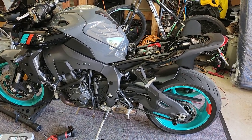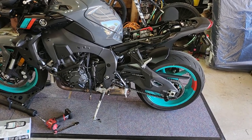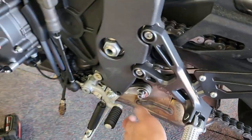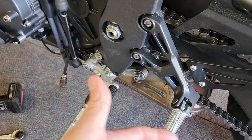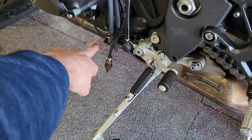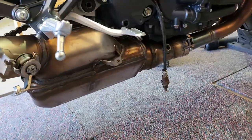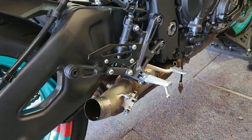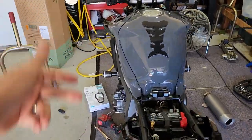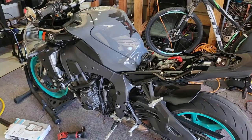All right, so we'll finish up this episode of Dave's Garage. I'm going to remove the cat I had put in loosely just so it wasn't blowing out my eardrums when I fired it up. I just need to take out that one bolt, remove that, and all I've got to do now is wait for the Leo Vinci D-cat to come in. I'll do a video of putting that on. I need to put in my O2 sensors, clamp the pipe on the headers, and there'll be one mount somewhere over here. Then put my muffler back on — at that point we're flashed, tuned, and ready to go. Hopefully I'll do a ride review, and having the wheels moving in harmony front and back should sort things out. I don't think this is an issue with the flash so much as taking the ECU out forces a recalibration that has to take place for everything to get back to normal.